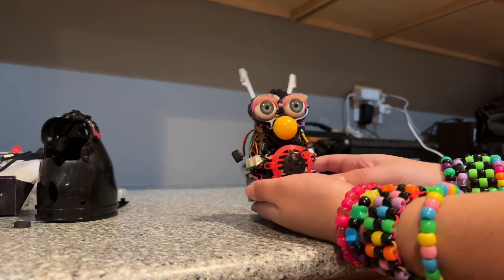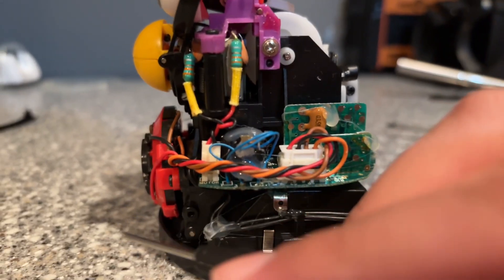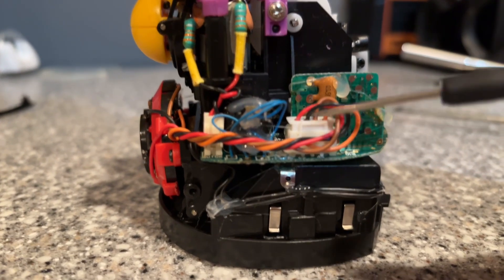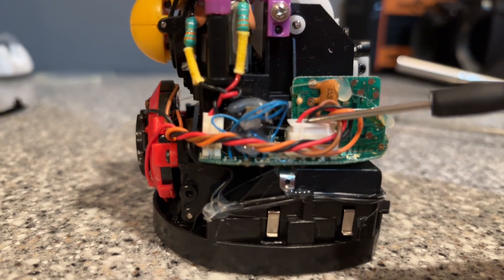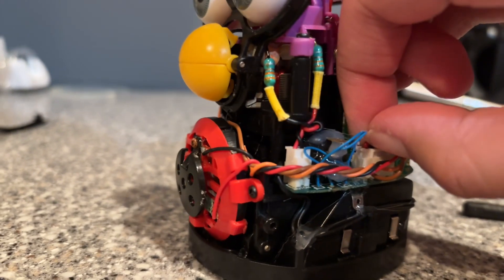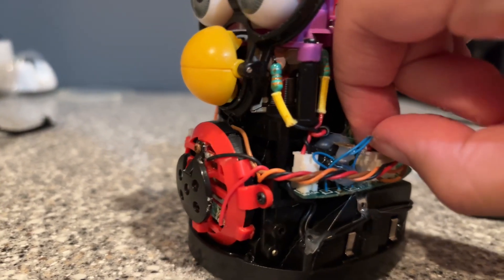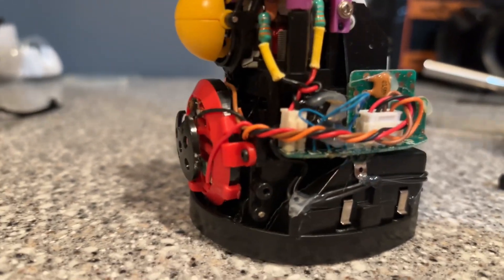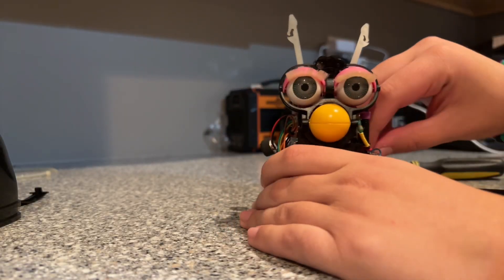So it's still turning on — that's a good sign. As you see here, the speaker and the tummy sensor are all attached to this socket. It plugs in there — so that's the socket and that's the plug. What you're going to do is pull it out. It's going to be kind of difficult depending on the Furby you have. I've had one that was easy, but most of the time it's going to be kind of hard. So you have to pull it with your fingers, or if you'd like, you can use some tweezers. Be careful not to break anything.